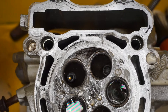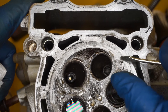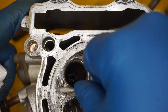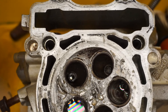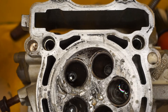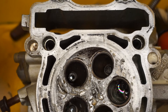That sharp edge is either part of the piston, part of the valve stem, or valve head. So we've got to get this all cleaned up and find out how much metal is in this head. Hopefully we'll be able to get new guides in this thing after we weld it up, and there will be enough material there to cut in new seats, put the valves in, cut the valves and seats together, lap them in real nice, and maybe we'll be able to salvage this head.